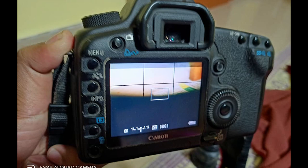This gentleman posted the other day in one of the classic lens groups that his mirror is getting stuck and he can't take a picture. So imagine you're looking from inside the camera — this is where the top of the lens would line up with this adapter onto an EOS full-frame. This would hit the aperture tab mechanism right here and it would strike the mirror on its way back down.